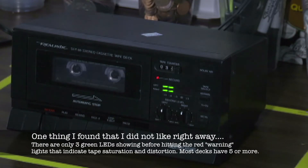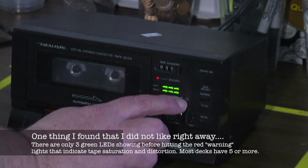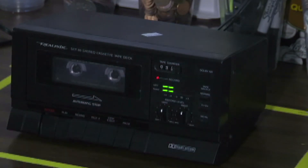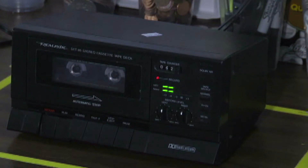This LED setup is kind of cheap. We've only got three in the green and there's two in the red. The last green one right here is negative three decibels, and then there's a Dolby symbol which I presume is at zero decibels — that's your target when you want to record and hit the best maximum output level on the tape and still have noise reduction kick in. There's also a second red at positive three decibels. Usually when you hit those levels your tapes are going to get saturated, unless you're using a really good chrome tape like I am or a metal tape. Those tapes can handle higher recording levels and more maximum output levels. There's a nice little bass section I threw in so I can check the frequency response on the low end.